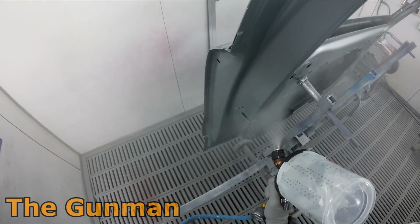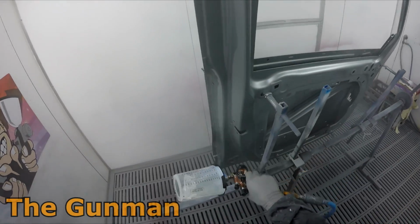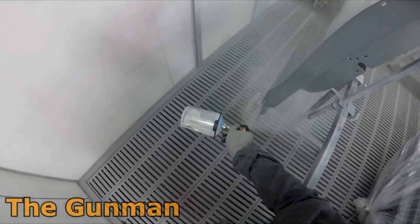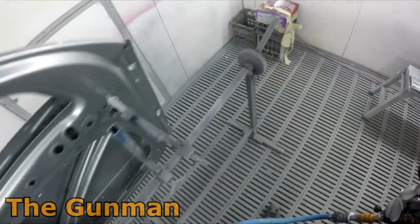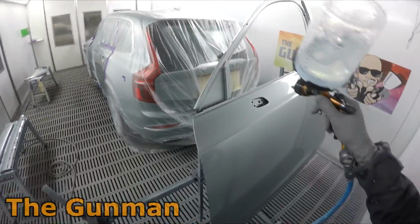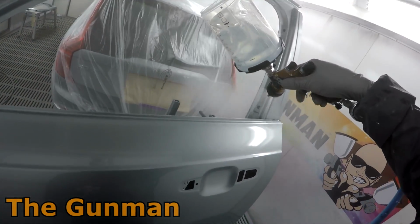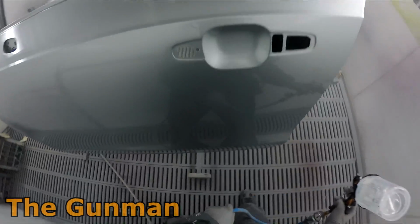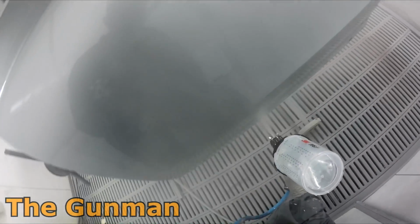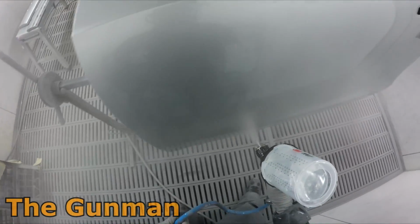But the clear coat I'm using, look, it's not the best clear coat on the market. That's the Standox Standard Clear. It's a funny one. When I first started spraying this, I thought, oh, it's a VOC clear, so you can tack and whack it. Then I looked into it more, and it's actually not even a VOC clear, but it uses a VOC hardener. It was only last week that I quizzed one of the paint reps on it, and he said it's a hybrid clear, between MS and HS. So it takes a VOC hardener, but it's not a VOC clear. It's a funny one.